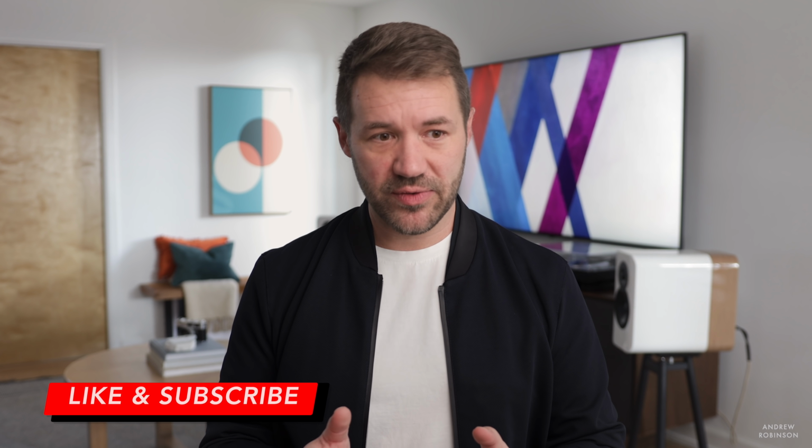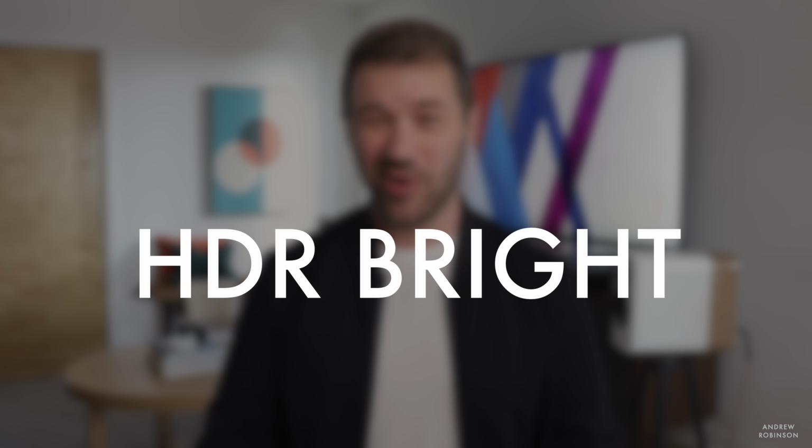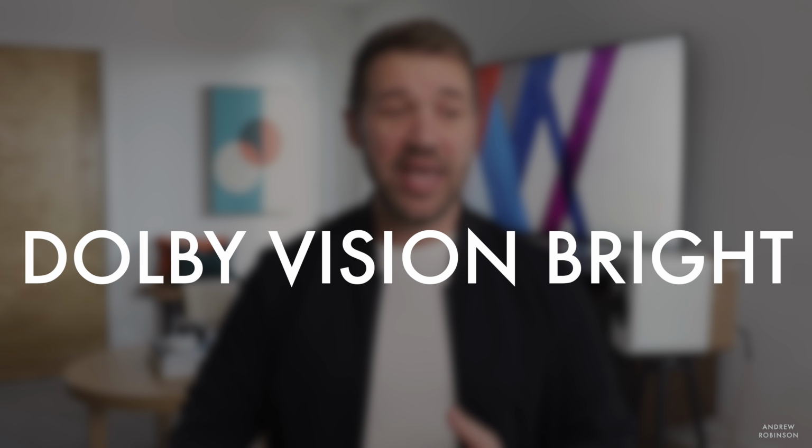Now there are multiple forms of HDR. There's HDR, there's HDR10, there's HDR10+, HLG, Dolby Vision, and all of these different formats or flavors have their own rules and standards. The point is that when your TV senses one of these signals, it's going to change its picture profile into something that it thinks is going to look best. And this is often going to be, say, HDR standard or HDR bright or Dolby Vision bright, and it's going to look different than the movie-centric profiles we spoke about earlier.